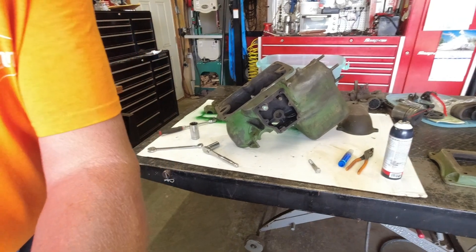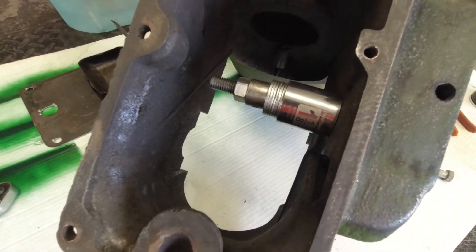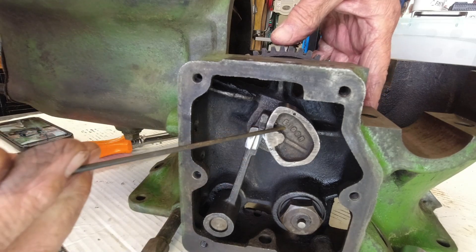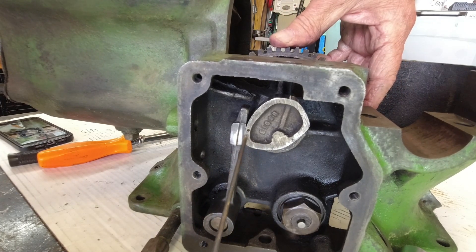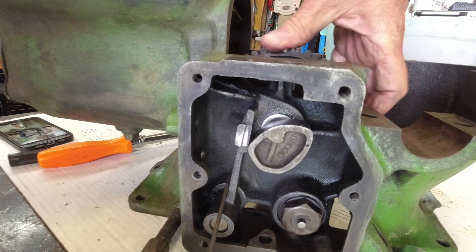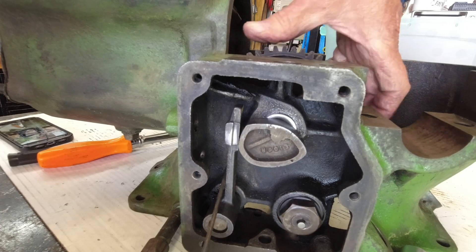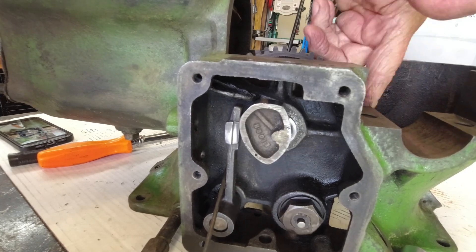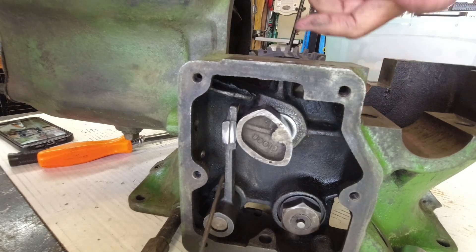I'm at the end of my threads, so I've got to add some more spacers — I'll add my longer socket. I went ahead and pushed the bearing back in. I've got it set up so these points are pretty much equal, so when the thing runs the follower is pretty centered on the face of the cam. I think that's working great. I'll go ahead and reassemble the engine now.